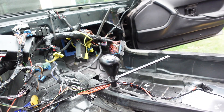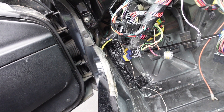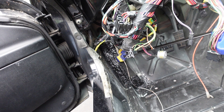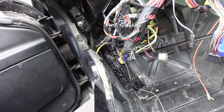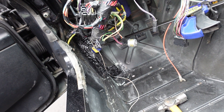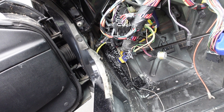The other stuff expired at 2019 but that seemed to harden up. This stuff is taking a long time to harden even though it has the same work time. It's also way colder, and that definitely plays a huge role — it's going to catalyze way slower in cold temps. So if you're unsure about this, do it on a hot day because you'll have much more working time.